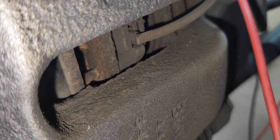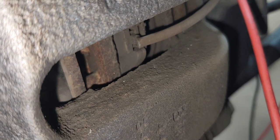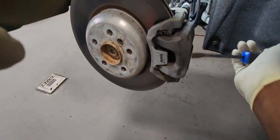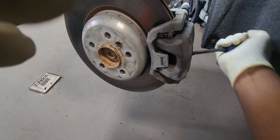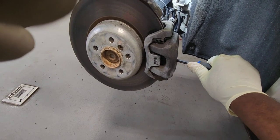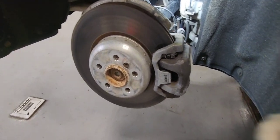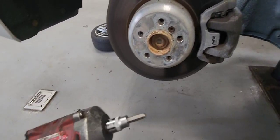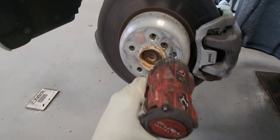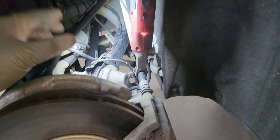The caliper is going to compress itself — the motor is going to pull back and you will be able to compress the caliper. You're going to know when it's pushing against the rotor. It's going to drop a little bit and there's some resistance to it. Now let's remove our caliper — it's a 6mm allen.